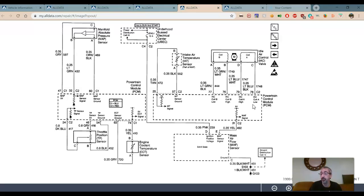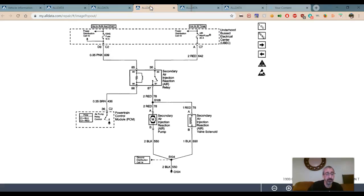Right? That proves a couple things. One, that the idle air control operates, that the idle speed can be controlled by it. And if we have a vehicle that has a stalling issue and we can see that that thing can play with the idle, maybe that leads us to a dirty throttle plate or something along those lines that causes that to be skewed, or a vacuum leak or stuff like that. Right? Kind of cool. Let's see what we got next. We got this one.